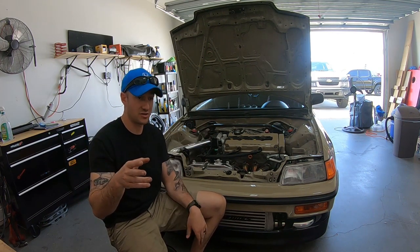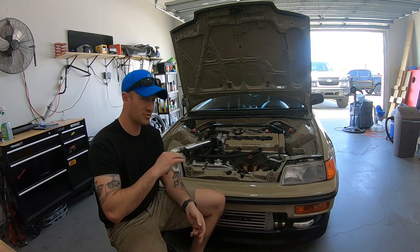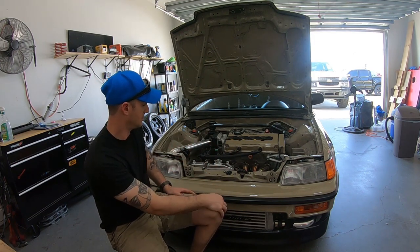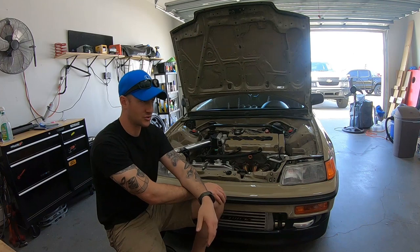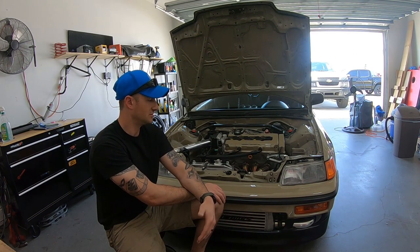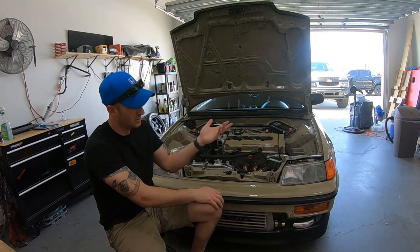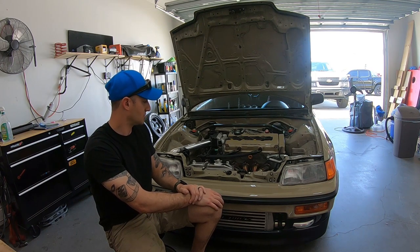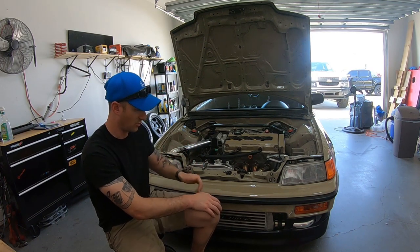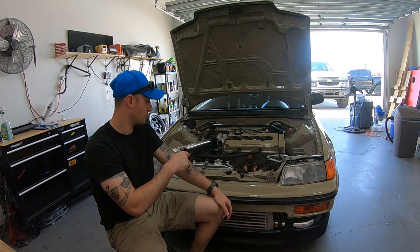If you're looking at the radiator, I'd honestly just jump straight to Greg's race package that includes the shroud and the same Spal fan I already had — that combo keeps the car smooth sailing. The intercooler does block some radiator airflow, so I built those little air vents and I'll keep experimenting. The fan does sometimes run continuously when driving around town, but the temp never goes above 197°F, so it's not a big concern — just the fan running. The cooling system overall is great.